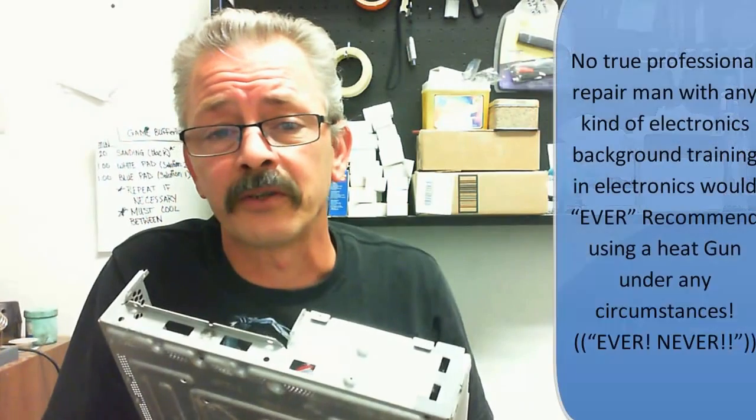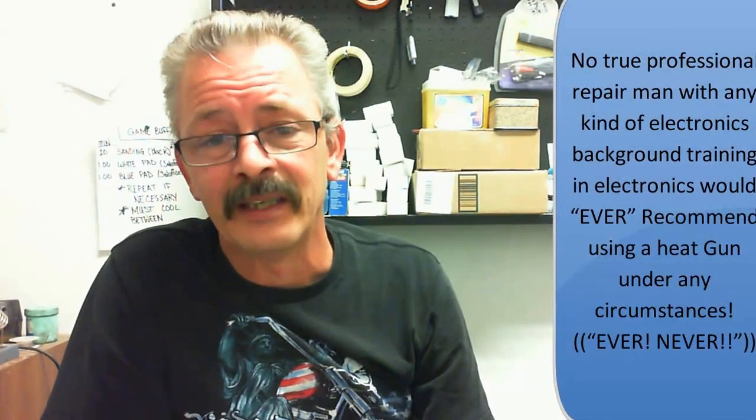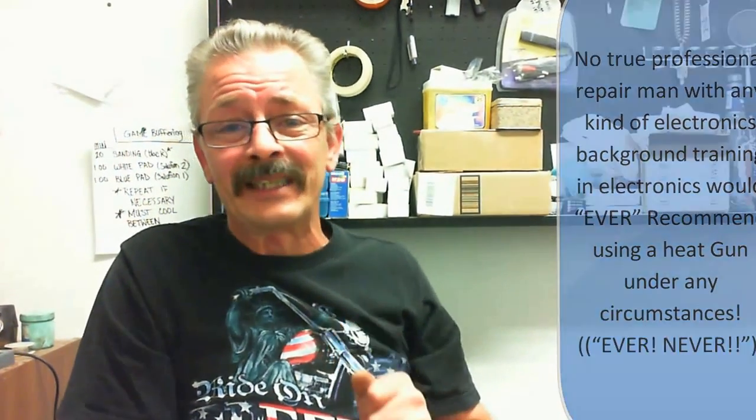Now, are they going to admit to that? Hell no. Do you think anybody that's telling you that they're a professional that's using a heat gun is going to say, yeah, 60% of the time I lose a box? Do you think they're going to say, yeah, 60% of the time I lose a box because I popped the solder beneath the chips, or I got the chips too hot, or I warped the motherboard so bad by putting too much heat in one spot that it did it, or I accidentally popped the solder underneath the chip that wasn't supposed to be reflowed.